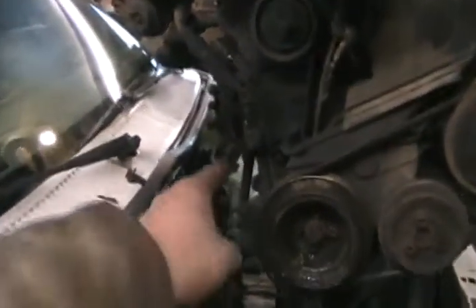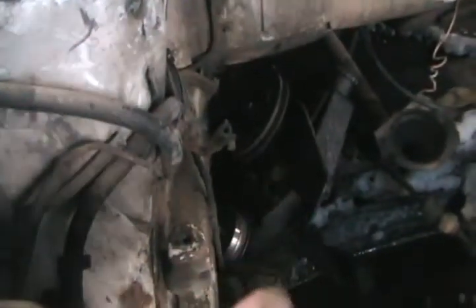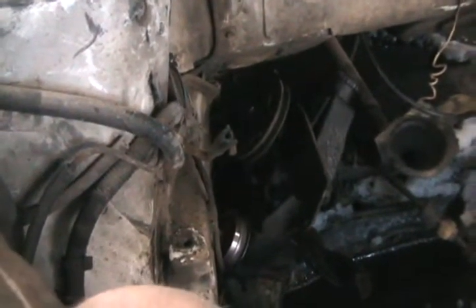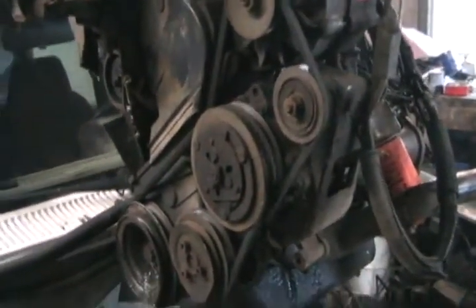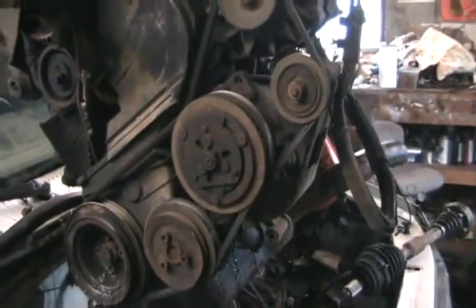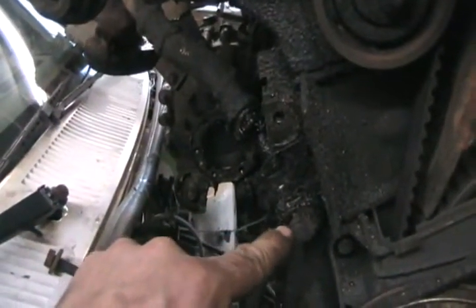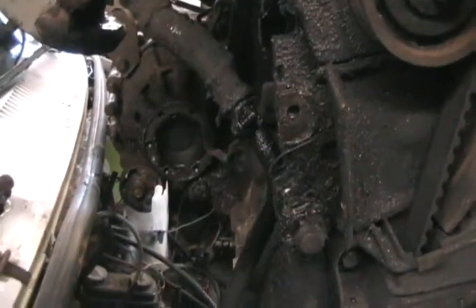On the front of Volkswagen motors, they have another mount that comes out here — I just unbolt that and take it out of the way. Down there is my power steering pump assembly with bracket that was broken off, with the broken bolts. That's the Chrysler pump. Volkswagen would be mounted here at the front, but Volkswagen pumps suck — they always go bad and get broken off easy when jumping and hitting bumps. So I made this special bracket that attaches the Chrysler one here. One bolt broke, and it looks like another was a piece of the flange. Another one broke back there too. I think I can get them all out — looks old enough that they're not seized.